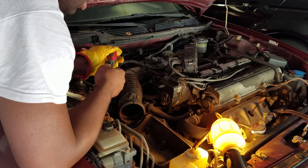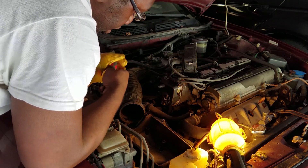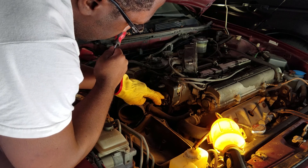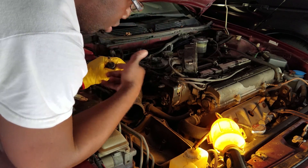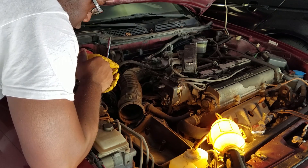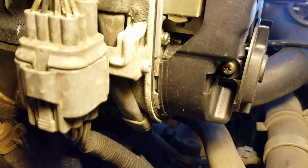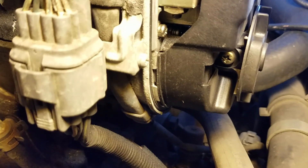What usually fails on these cars, these Hondas, is the coil pack and the igniter. It looks pretty good, but you never know until you get in there. I can't get access to the coil pack until I get this rotor off. The problem is the rotor is in a bad position — I have to rotate the engine until I can access the screw to take the rotor off the assembly. There are multiple ways to do it. I finally got the engine rotated to the proper position, and I'm trying to get that Phillips screw aligned with the access hole.